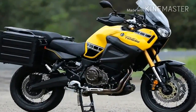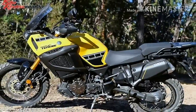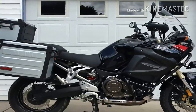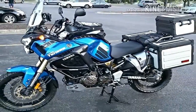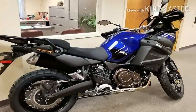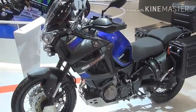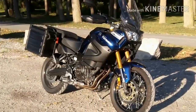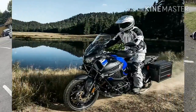Yamaha really put some power in this ride. The 1199cc water-cooled inline twin uses a 46-millimeter Mikuni throttle body and a downdraft intake to produce 86 pound-feet of torque at six grand — plenty for on or off-road work. Uneven power pulses from the 270-degree crank arrangement gives the rear tire plenty of time to get a grip between pulses, like a tractor, for enhanced soft surface performance.